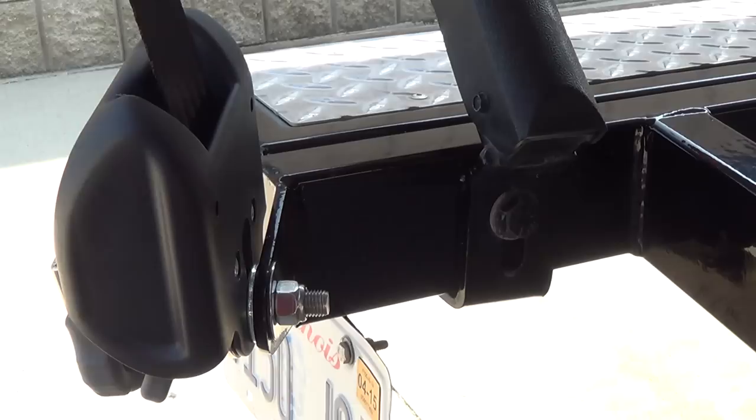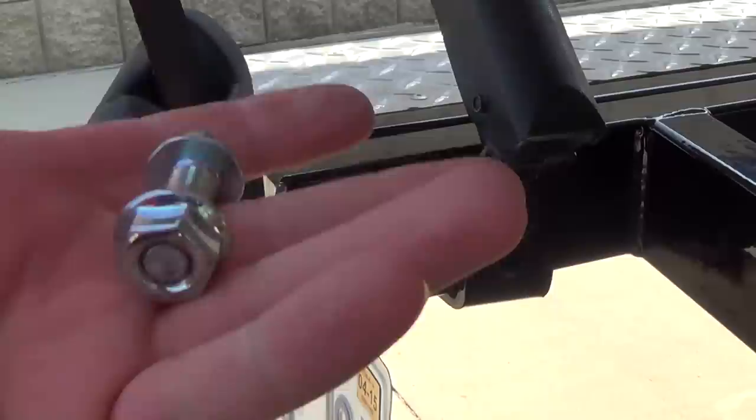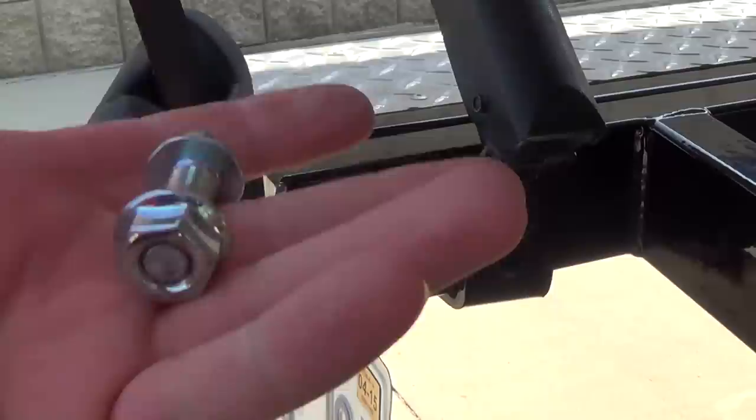This is the stainless nut that comes with the stainless steel kit, and you cannot tighten it down all the way by hand. With two wrenches I only got a couple more turns, so if you use this one keep that in mind — try an impact wrench or just get a different nut. Here I'm using a stainless steel nut but it's a nylon type that will tighten all the way down, and I can back it off if I want to.